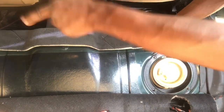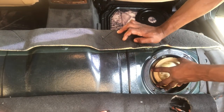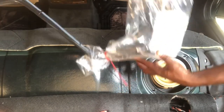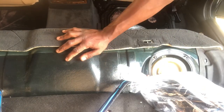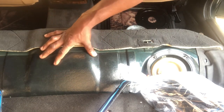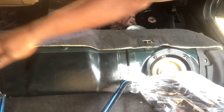Now we have to go to the other side and repeat the process, so we can remove the hose that runs from this side onto that side. Basically this new unit fits in here, and this hose runs from one side of the tank to the other. It appears as if there are two tanks but it's one tank — because of the driveshaft assembly running along the center of the vehicle, the tank has a hump over it. This hose takes fuel from the right side of the vehicle to the left side.